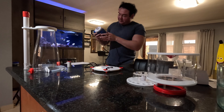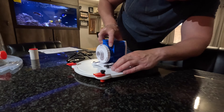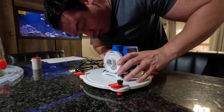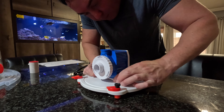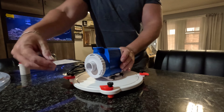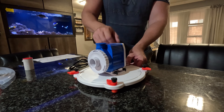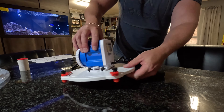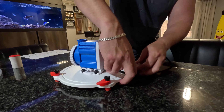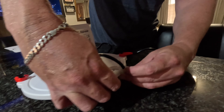So let's put the pump in — slide from this side. Make sure it's clicked in, otherwise when you push the inlet in, it will push the pump out the back. The back here is a place for your wire to go — put this through here like that and push the rubber through.